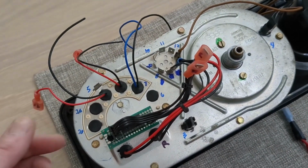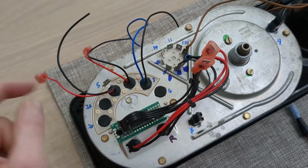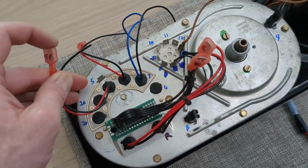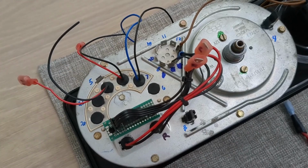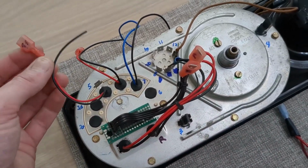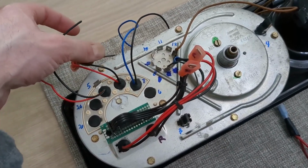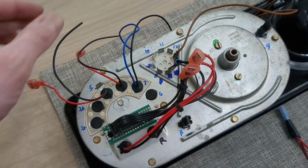But what I didn't realize was, just for the turn signal, which is my turn signal now, moved over to here, the wire itself, I assumed was the positive wire, which it really wasn't. The wire going into the back of the bulb was actually the negative. So what I have to do now is I disconnected these. Originally I had all three of these just connected and plugged into the chassis ground.